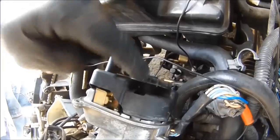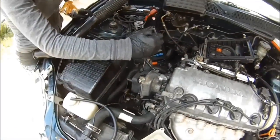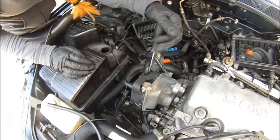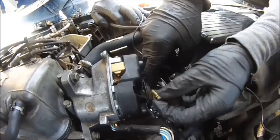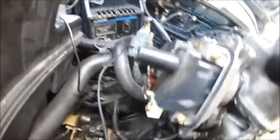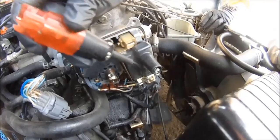On these Civics there's a bolt that holds the rotor. You just barely turn it — there it is. Just expose that bolt so you can get the rotor off. Make sure you push down real good on that bolt because if you don't you can strip it — I've stripped a few of these. I had to chisel the whole rotor off on a couple of Civics because that bolt gets rusty. With the ignition switch off, you don't hear the arcing anymore. Here's the rotor — let's take this off. Turn the ignition switch back on. Look at that — this looks all burned up. Earlier we got a spark without even doing anything. There's another arc right there.